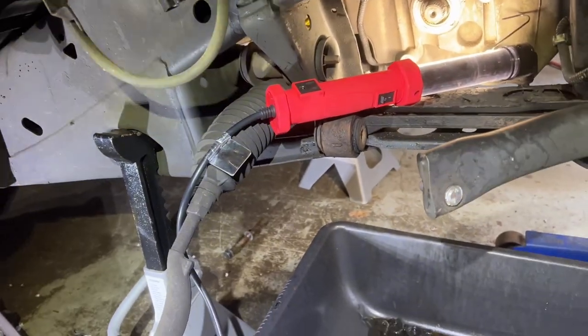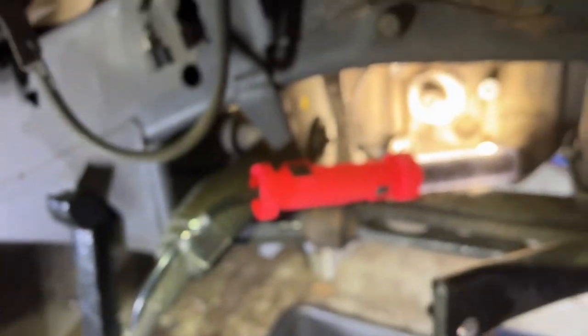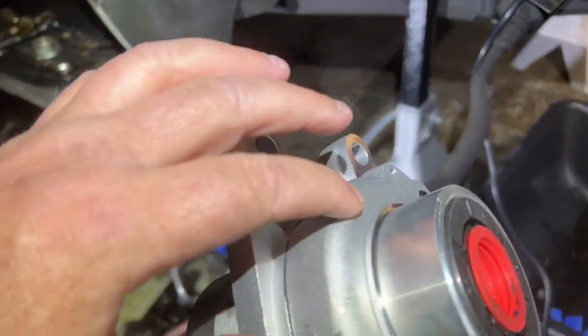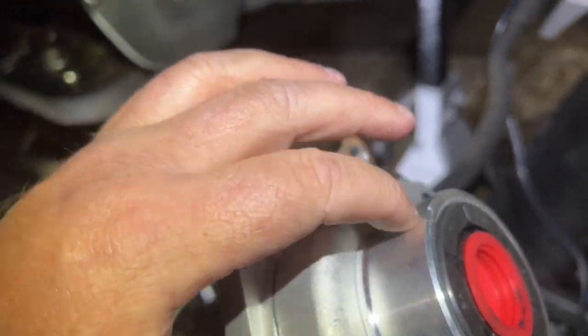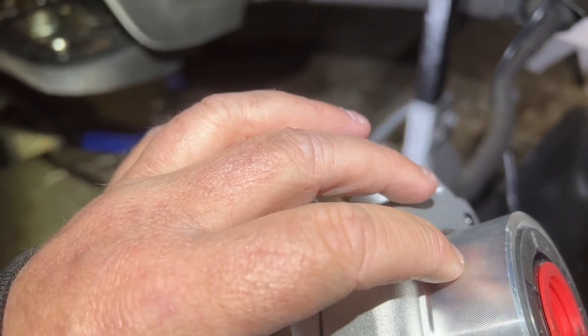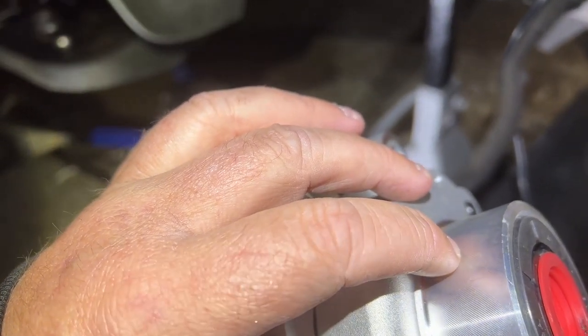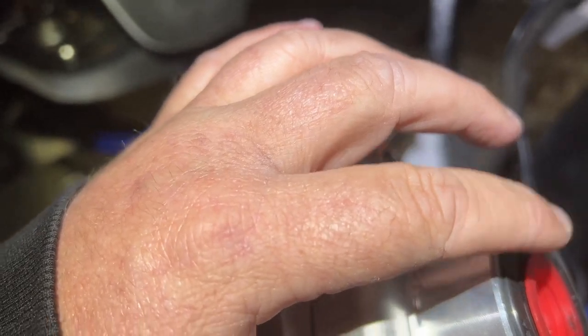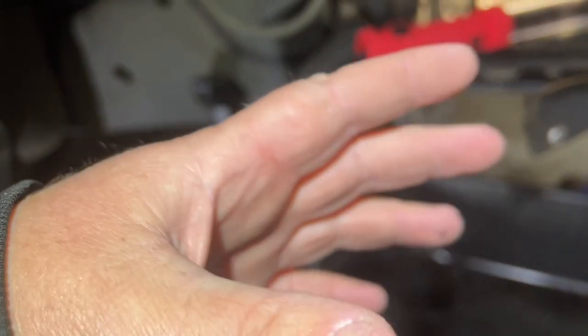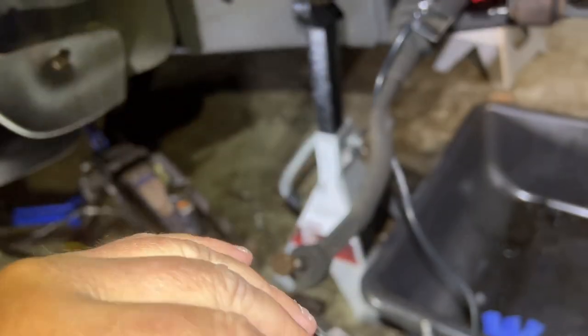Or now that I'm thinking about it, since this goes in 1 inch and it looks like I pulled the axle out 1 inch, I think I'm safe to work on this housing that's stuck without damaging that axle, because since it's out 1 inch, that inch that came out, if I damage that, that's here anyway when it's reinstalled. And you know, inside the oil pan, it's apparently just a hollow tube that axle goes through. So it shouldn't really affect anything.